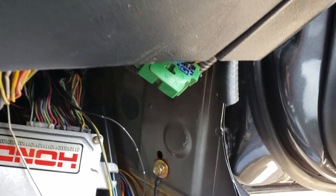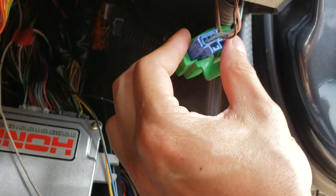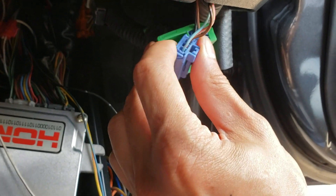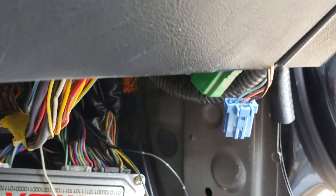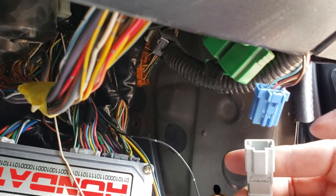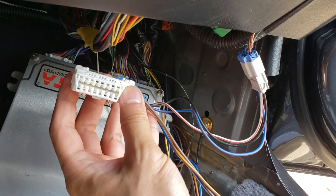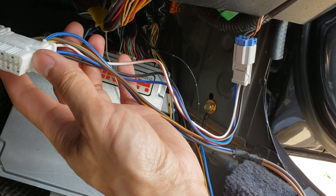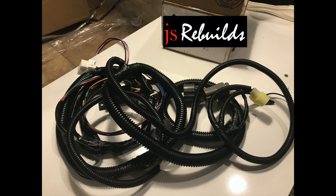The last plug is a three-pin plug from the conversion harness. On the passenger side, locate the green cover — find the three-pin plug and pull it out from the green cover. I believe this is the scanner plug and we will plug it into the conversion harness. Here is the OBD scanner plug that is on the conversion harness — mount this in a spot where you can access the OBD plug for a scanner to use. If you liked what you saw or this was somewhat helpful, please hit the like and subscribe button and share. Thank you.